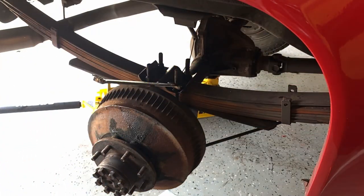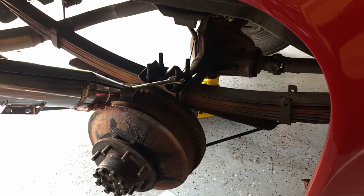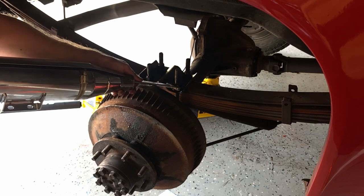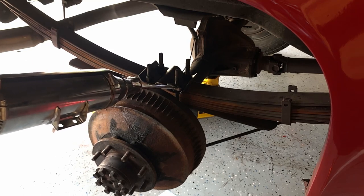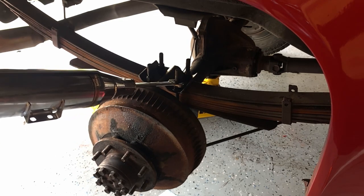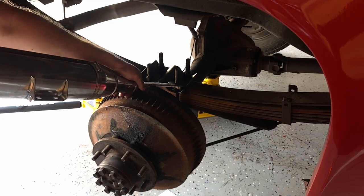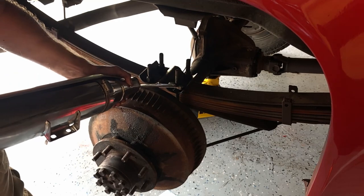Most factory and older U-bolts are going to be too tall to slip a socket over, so you're going to need to break them free using a wrench. Likely you'll need some sort of extension or breaker bar — whether a half jack handle, lead pipe, or in this case a motorcycle muffler. As you break each one free, be very cautious and keep an eye on the jack stands so that you don't put too much pressure and cause shear on the jack stands until you feel the satisfying click.